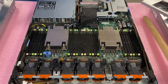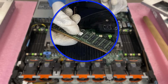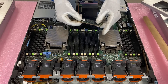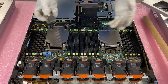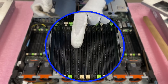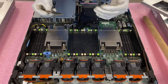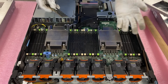Another tip: if you look right here, there is a notch — known as a key — that's not perfectly centered, it's just slightly off. This key is important because you have to line your module up just right. Otherwise you could potentially damage the DIMM slot or damage the leads on your module, and you don't want a broken module or a broken motherboard. If you look at the DIMM slots, there are tabs in the middle that stick up, and they flip flop depending on which side of the board you're on, so just make sure you're careful. The most common problem I see is someone breaking a module from being careless because they get in a good flow and it flip flops on them.